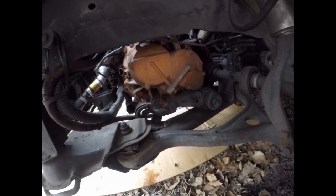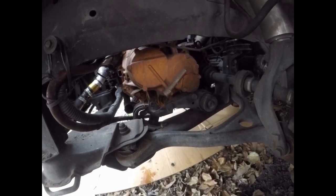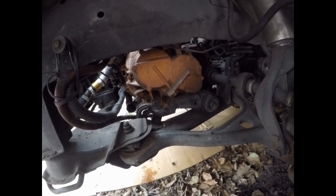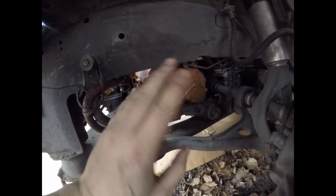So this is massive, and it really stabilizes the whole engine and transmission. Basically took away all of my wheel hop for hard launches, and it just helps stabilize everything. The shifts were actually smoother from less play, less rocking in the transmission. I don't know if it was due to the linkages stretching as the whole motor and transmission rocked, but yeah, dude, the shifts are way crisper, way more direct.